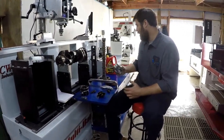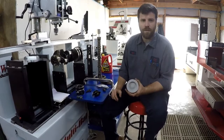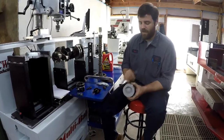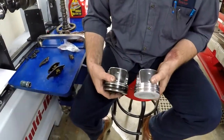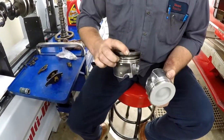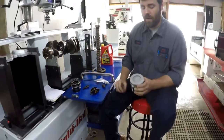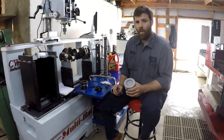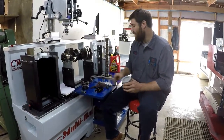That's one thing we do differently, and we have several others. The factory piston design had an issue with piston-to-wall clearance. The coefficient of thermal expansion wasn't taken into account at the rate at which the piston would expand. We start seeing skirts that are scuffing — you can see the scuffed skirt on this piston right here from the factory. That piston is scuffing the cylinder wall because it's expanding beyond the rate at which it should. We increase our piston-to-wall clearance to make sure there's no issue with the piston contacting the cylinder wall, and that helps us get greater longevity out of these engines.